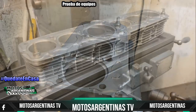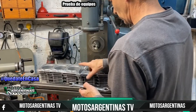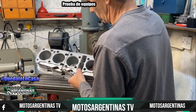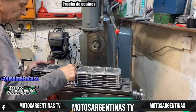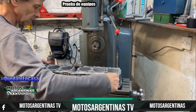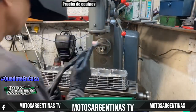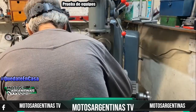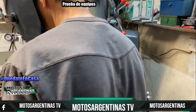So that's that done. I can blow off with an airline to remove all the dust, and I can take the barrels off, turn them upside down, and bolt them back down again onto my milling machine, and weld the bottom side joints. With the barrels clamped upside down in place on the milling machine, I get out the TIG welder and weld all the joints that I can get to across the bottom face and down the fins.